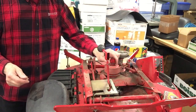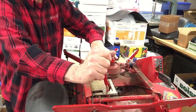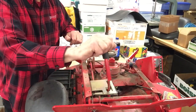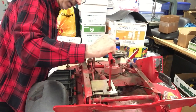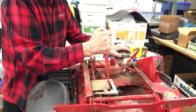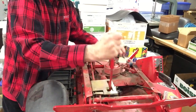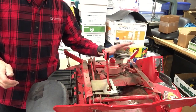Now if the mower was on the machine it would be a little bit more difficult. This one I cannot turn by hand until I engage the deck, which releases the brake. Now I can turn this until that slaps back down and that locks the brake. And this is acting a little sticky to me — this needs to be oiled.